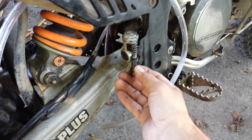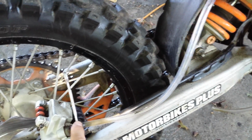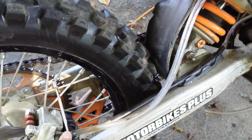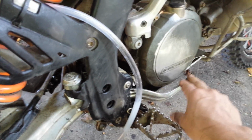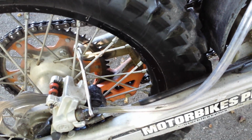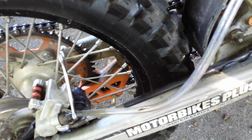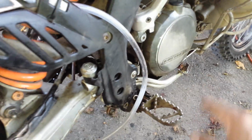it. And typically the way you bleed it is, first thing is get a hose and run it up so you don't get any air bubbles. This one's an 8mm wrench on it first. So typically what you do is, with it closed, you pump 5 times, hold it down, and as you're holding it down, open that up, and you'll see some air come out. And then close it, and then release your brake pedal.